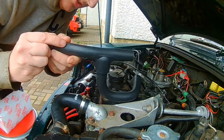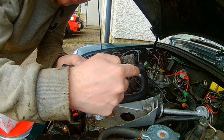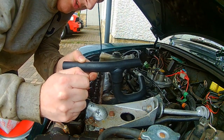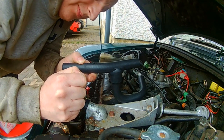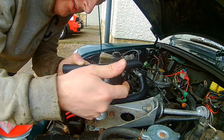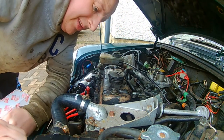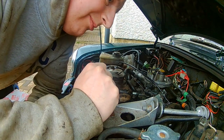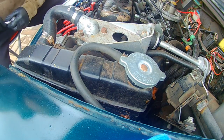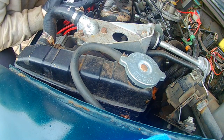When I felt this the other day with the engine up to temperature, this part was hot, this part was hot, and this part was cold. When I get the old hose off I can compare the shape with the original part and check this join for some kind of blockage — that's the plan. To get in here, this engine steady bolt has to come off. I've not drained any of the coolant system because I'm working at the top end of the engine just now, and if I get spillage I'll just clean it up.